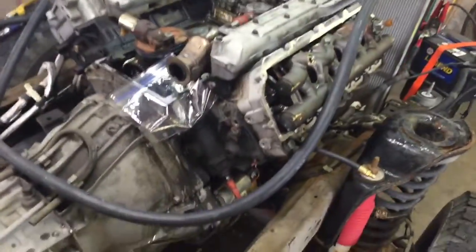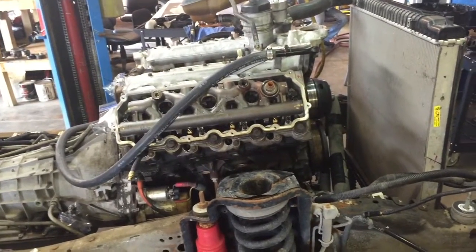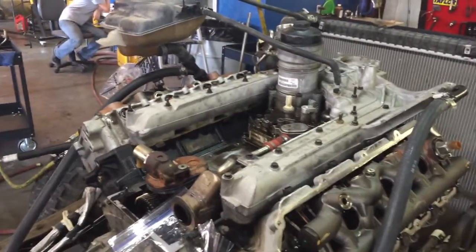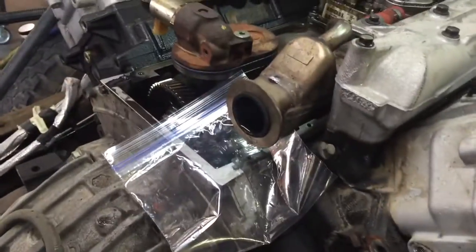Went ahead and put different oil in it. We're just going to crank it, do a compression test, and then see how milky the oil is, because we know right now, I drained the oil cooler, it was empty. The reservoir, everything was empty. So that oil, when we drain it after this compression test, should be black, because if it is just strictly a failed EGR cooler, which you can see dripping right there.